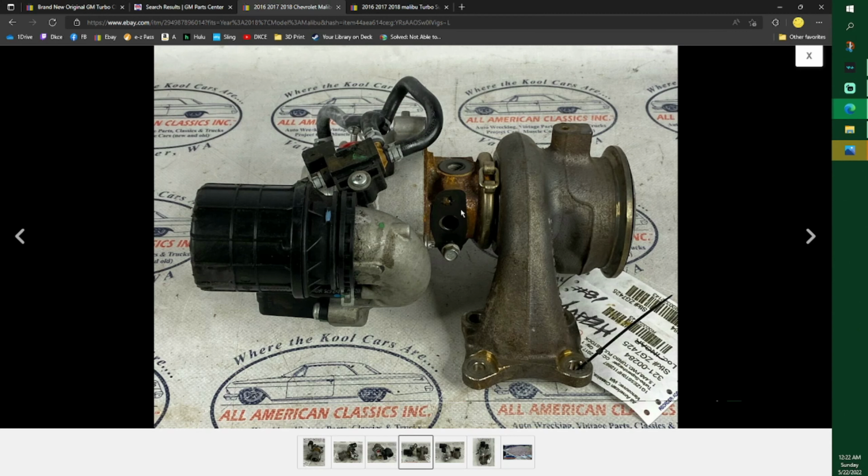So I put it perfectly on the block. I pictured that, the block that's underneath here, the oil return line, and I put this on there perfectly and slid it in, and then the bolt closest to me, I threaded it in, and then I went below with a really long screwdriver and stuck it up through the hole, and see it's off just a little bit. I pushed it over with the screwdriver and made the hole line up, and then I stuck the bolt up there and it screwed right in. Thank goodness. And this also isn't a normal shape.